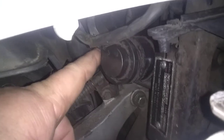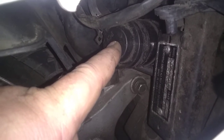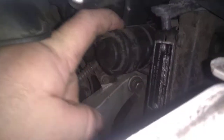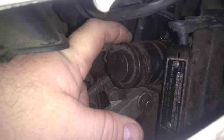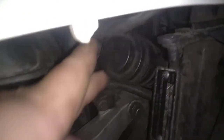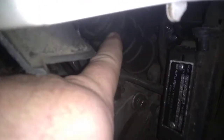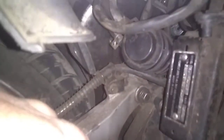There's that little line coming from the vacuum — and what does that say right there? Positive Crankcase Ventilation. It puts a vacuum on this diaphragm, which then internally — there's that hose that teed off to it — it opens this valve for the PCV valve. Coming off the other side of the vacuum port is the line that goes off to your fuel system and your petcock. There's vacuum on it. You can see it right here. We have a vacuum can, which is your charcoal can. We have vacuum on the valve. We have vacuum coming here. We have vacuum at the air box. There's most definitely vacuum on that line.